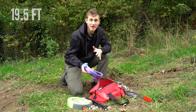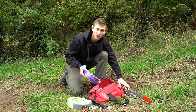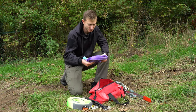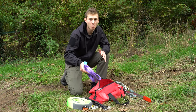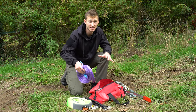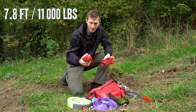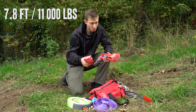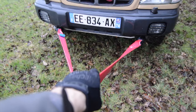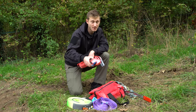I also have a 6-meter long strap to extend the line of my hand winch, which is pretty short — around 1.5 to 2 meters. So I get 6 more meters here. The rating is about 5 tons, which is great. This is not a snatch strap, so the exact rating matters less. And I have a pair of 2.4-meter, 5.5-ton rated straps as well. Those are useful for the front of the car in order to use both recovery points to divide the load, which is way better for the car and the recovery. They can also serve as an extension for the hand winch line.